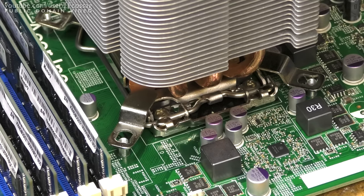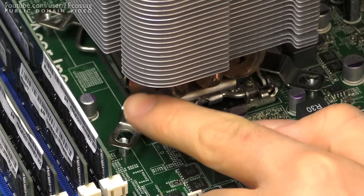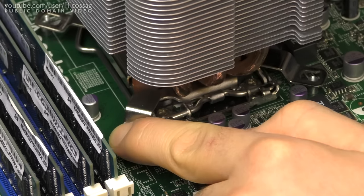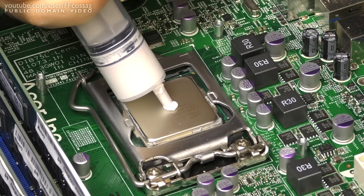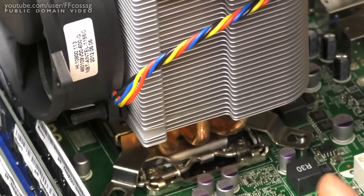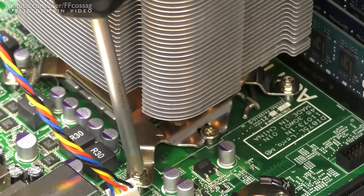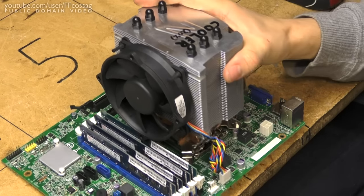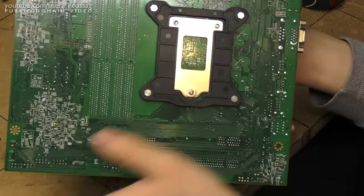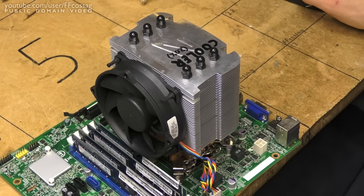Here's a close-up of how well the CPU cooler actually mates to the LGA1155 screw holes. As you can see, these holes line up rather perfectly and I've bent them up ever so slightly just to give it a bit more spring tension as we bolt it down to the motherboard. That's going to be sitting there very sturdily. And let's bolt it down. That cooler could not receive a better mounting — it's on there rock solid. That's a nicely recycled LGA775 cooler which is going to be more than capable enough of cooling this processor.